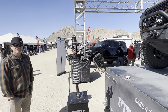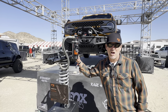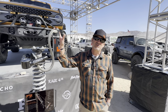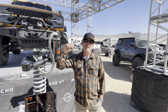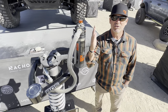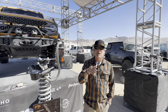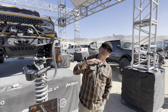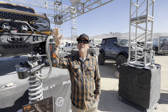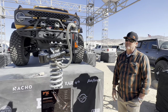Let's talk about the technology of this shock for people that don't understand what a Fox is. Jason was involved in the design of the shock. This body is our 2.5 coilover — Jason has his signature on the shock, and he's been involved in the valving as well as the tune that comes on the shock when we deliver the vehicle. The vehicle has high-speed and low-speed compression adjustments at the top of the reservoir. You're able to control the low-speed compression, which equates to the sway or lean of the vehicle at lower speeds — almost like an adjustable sway bar. If you're on the pavement and want the thing to stay tight on freeway on-ramps, you can stiffen up your low-speed compression so the vehicle doesn't lean. High-speed compression is what we're doing out here at Johnson Valley — hitting stuff real hard, you want that shock to eat it up and get right back to the ground. That is also six-way adjustable on this vehicle. The shock is made out of aluminum — many competitors use steel, so it is lightweight. Aluminum also bleeds off heat better than steel.